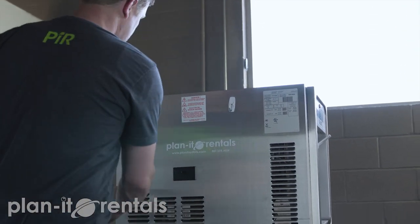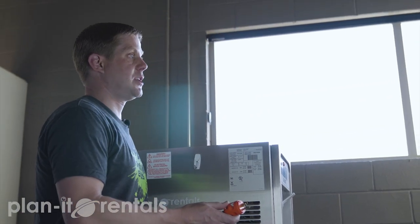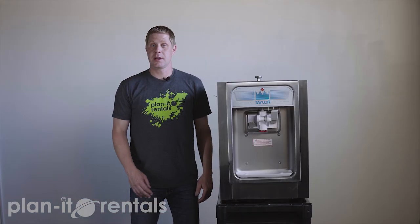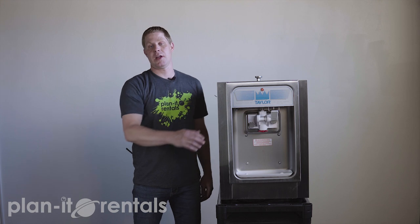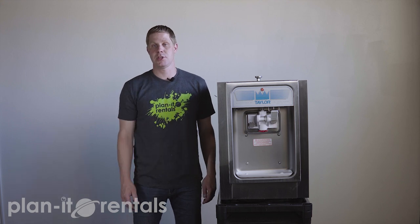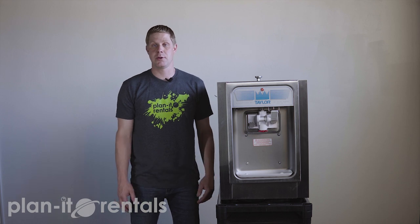Power is the most critical factor to running the machine. The machine has about a six-foot cord and you'll want to plug it straight into a wall. If you're not able to reach, we do rent extension cords for five dollars — we don't allow any other extension cord to be used because we can't certify the thickness or gauge of another cord or the condition it's in. There's a capacitor inside the machine that will go bad if it's run with inadequate power. When you pull down that lever and the compressor doesn't get adequate power, it will blow that capacitor. We test the machine between every use, but if you repeatedly run it with inadequate power it will damage the machine and you will be responsible for the repair. We rent 50-foot heavy-gauge certified extension cords for five dollars.